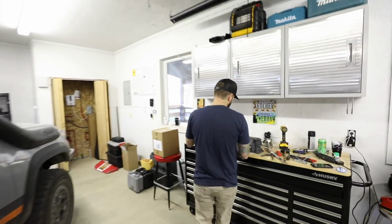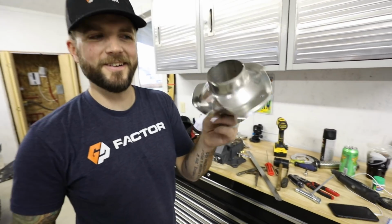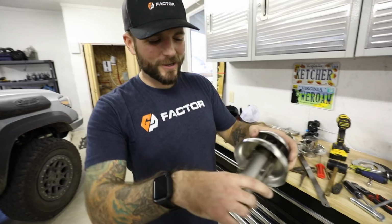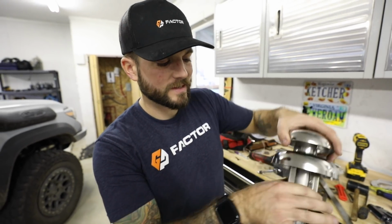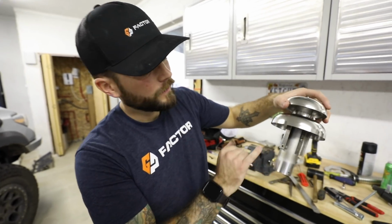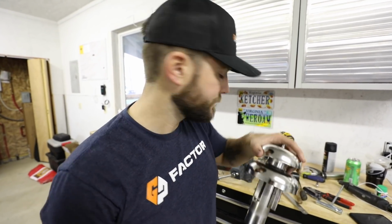All right, now that we have the chimney topper, the main flange piece, look at that beauty. These are some bigger spot welds than we had last time. We're going to trim down these legs on the inside, these flanges here, so that this can sit inside the top of the outside chimney the correct way. Then we'll be drilling some rivet holes and mounting this to the top of the chimney after we get the chimney on the outside of the camper.